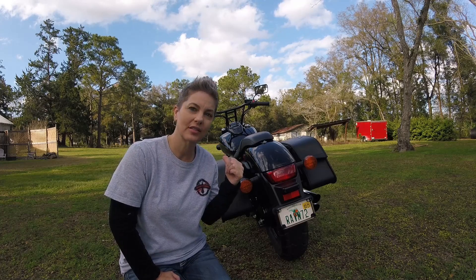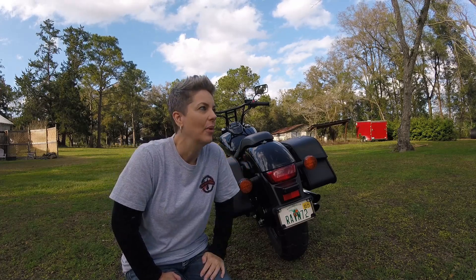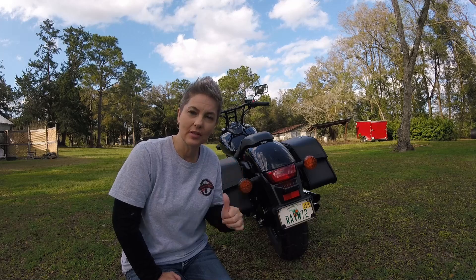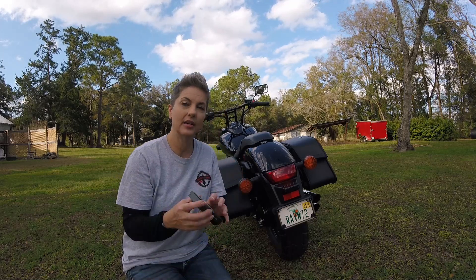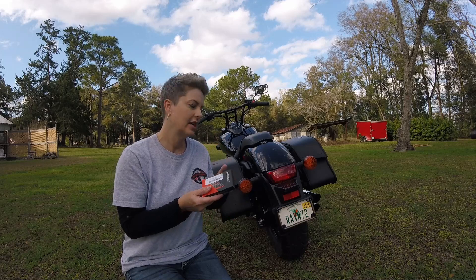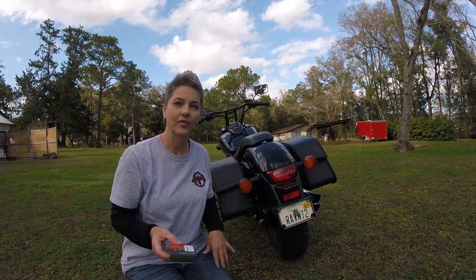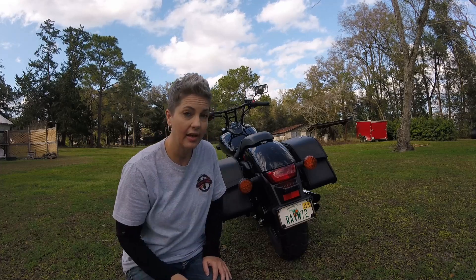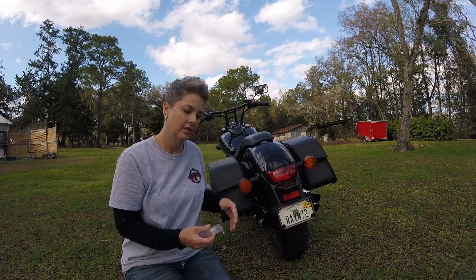Hey guys, I'm back and as you can see I am still working on tail light lenses — eventually I'll get it right. If you watched my last video, you saw that I installed some turn signal lenses and bulbs in the front that didn't work, then I ended up switching them out with some that did. In the front right now I've got smoke lenses with LED bulbs from Aux Light that I got on Amazon. I had ordered some of these for the back turn signals as well, but instead of ordering 1156s I ordered 1157s, so I had to send those back and trade them out for the 1156s.